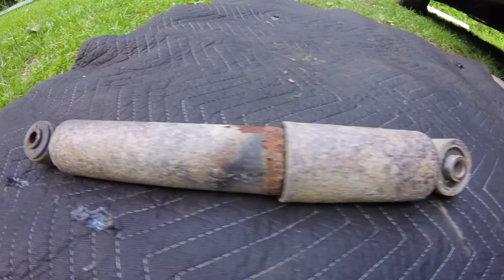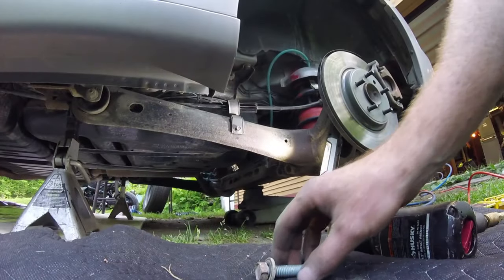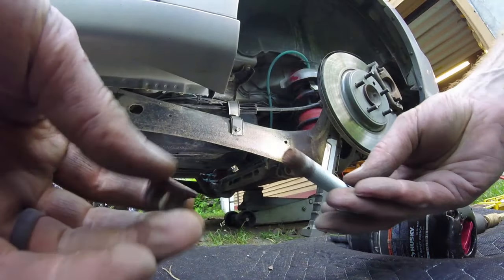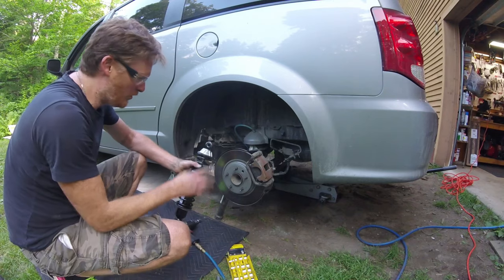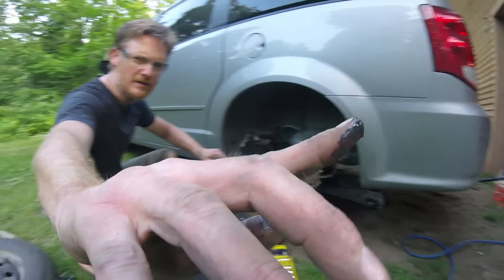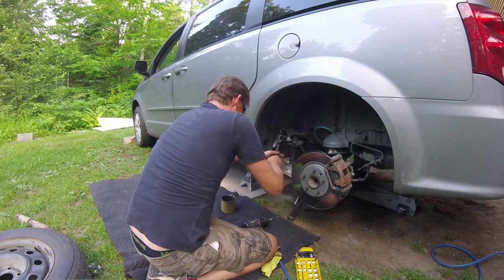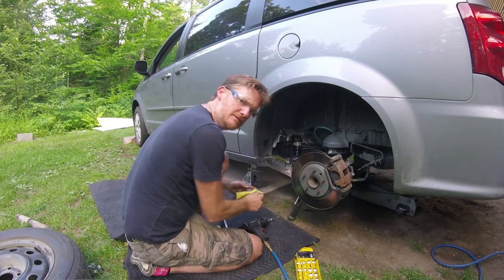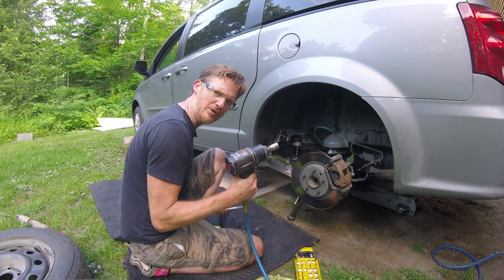By the way, not only am I replacing these because I need assistance with towing, but look at that thing. We'll definitely put some grease on this. And this is going to go — orientation this on the top. Grease. A whole lot of grease. And as always, you start the bolt and nut by hand before you put the air hammer on it. If you get it cross-threaded and air hammer it, you'll strip it.